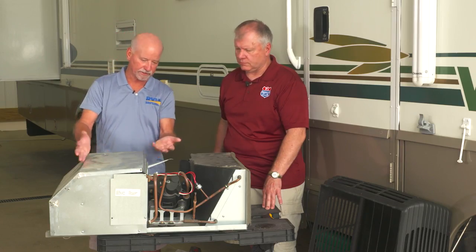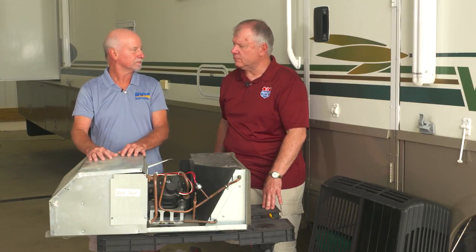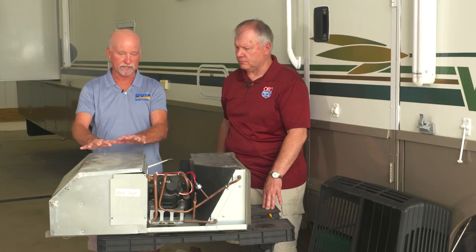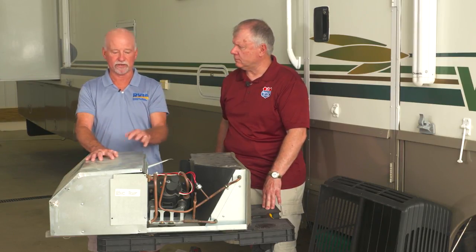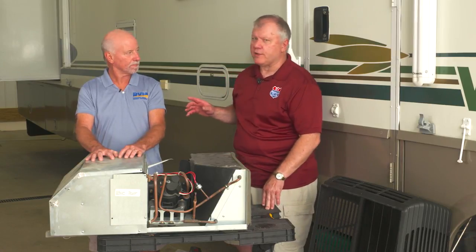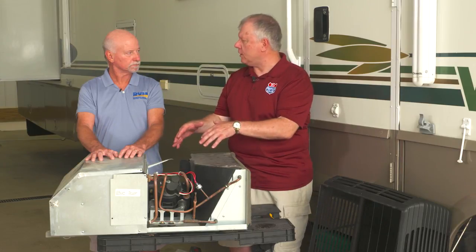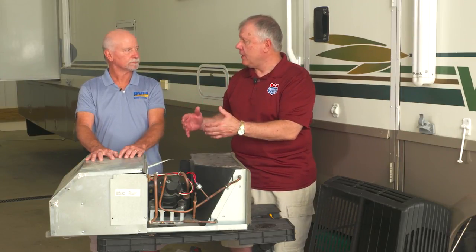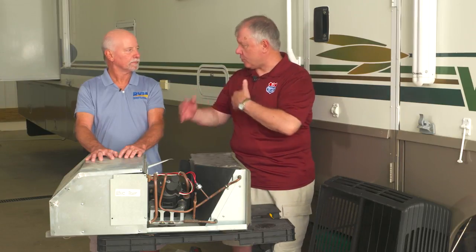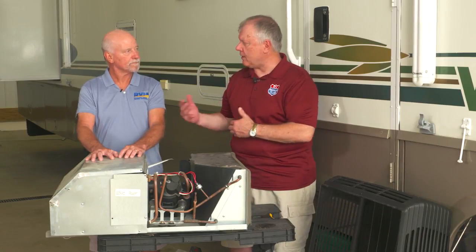An air conditioner could be something as simple as spraying air freshener in your coach — that's conditioning air. But this unit is actually drying and pulling heat out of the interior of your coach. A lot of people think an air conditioner is going to be dumping cool air inside — it has Freon, it's cold, so it must dump cool. But instead, it's actually pulling inside air. It's a closed system, drawing inside air and cooling that down.